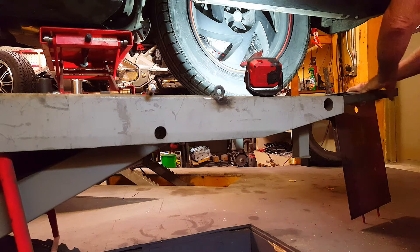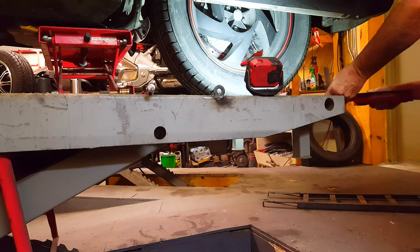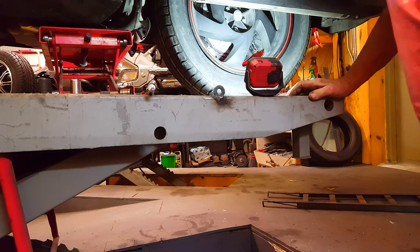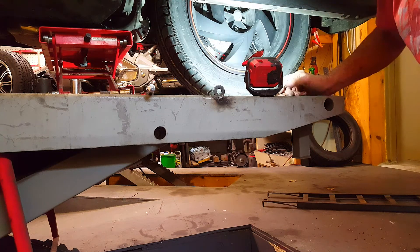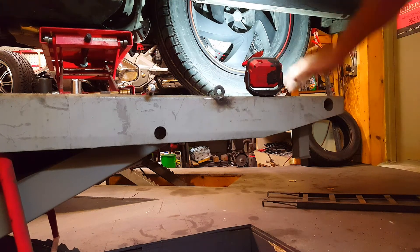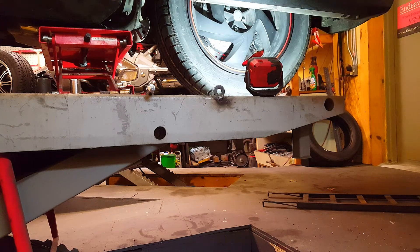I'll inflate the tire to 24 pounds. This one actually has a TPMS on it so it does have weights on the other end to nullify the weight of that. Typically I powder coat the rims silver, but this one was black so I left it alone. I typically replace the valve with a rubber stem — rubber stems in my opinion are superior to steel. Even though they're a buck a piece, they never leak, they never go bad, and you change them every time anyway.